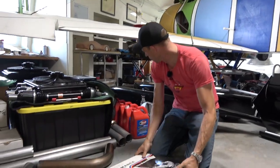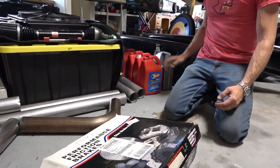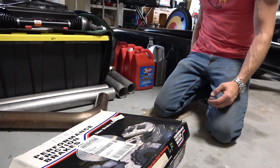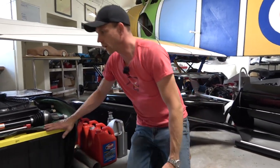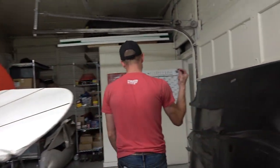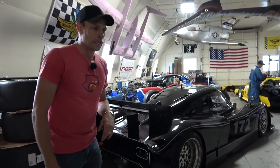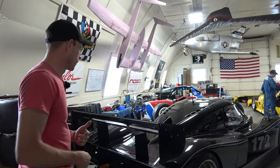Really nice to have all the special oil — they're running 10W-60 full synthetic because it's got that BMW M6 V10, which if you guys know from the street cars is very prone to rod bearing failure because of the nature of the clearances being tight. So if you've got one of those BMW M6s and you think it's a good idea to start it up cold and rev it — you're destroying your rod bearings. Let the car warm up beyond water temperature so the oil temperature comes up and you actually get oil flow. Just throwing that out there so you don't wreck your beamer — you're welcome.